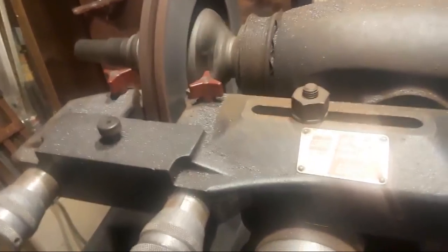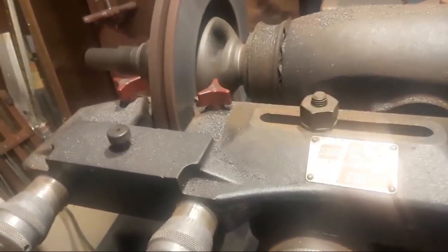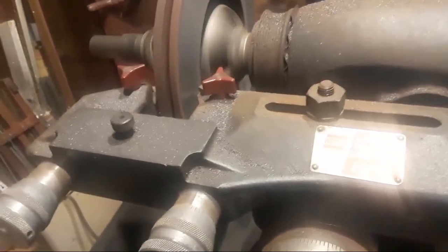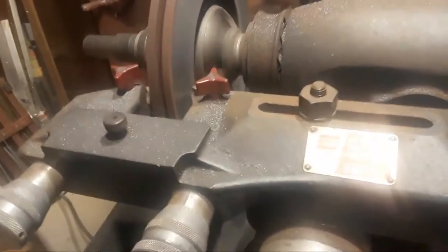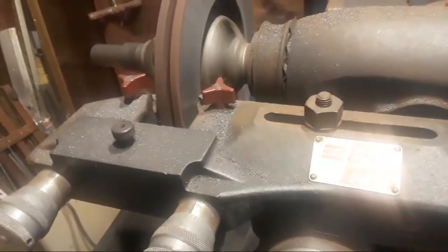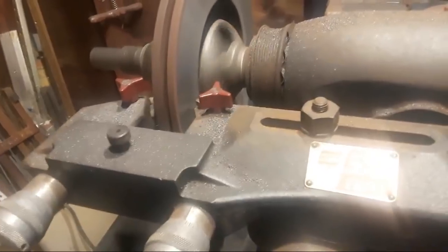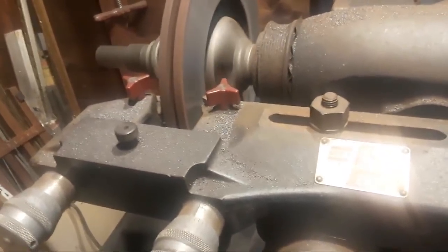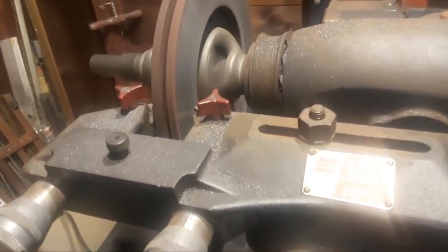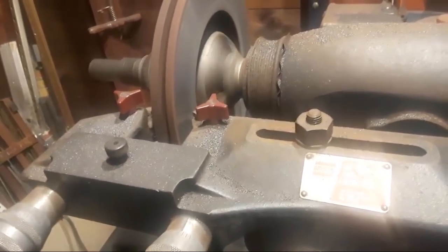You only need new brake rotors as part of an inspection, Ms. Char, if those brake rotors are either warped or scored. Scoring means that they have grooves in them from the pads getting too thin and it going metal to metal. Generally, it's less expensive to replace the brake rotors than to do the machining. Brake rotors have come way down in price. A lot of them, in fact, come from Brazil or Mexico or China. Those are the cheaper ones. I don't necessarily recommend putting those on. I recommend you put on a good quality rotor. But, you know, if you can't afford the good ones, it's the next best thing.